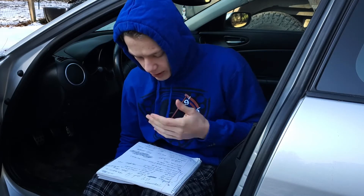Pre-mix tools came to $25.77. I pre-mix every single fill-up — I do an ounce or an ounce and a half per gallon of fuel, depending on how I'm feeling with it. The more you pre-mix, the angrier these things get. They sound so much better, they pop, crackle, and shoot a whole lot more flames the more you pre-mix. Pre-mixing comes with benefits: the OMPs — the oil metering pumps — in these cars are actually pretty good, but with any rotary, it's always good to have that extra lubrication. Even if you don't think you need it, I promise you that you do.